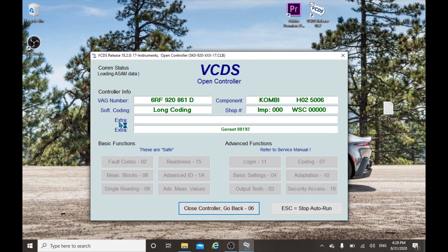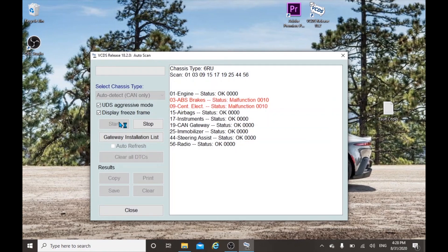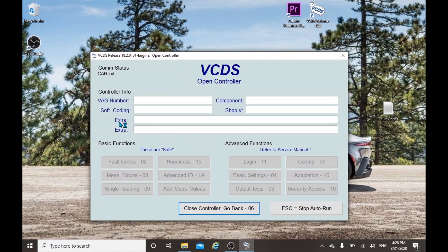As mentioned earlier, there are two faults present in the car. One of them is the ABS sensor. There is a faulty ABS sensor because we can see on the instrument cluster when we drive that the ABS light comes on while driving. However, we are not sure which sensor is faulty — it could be any one of the sensors, or it could be all four. So let's wait and check whether the software picks the correct sensor.